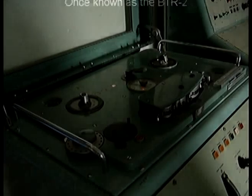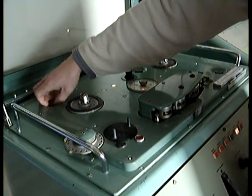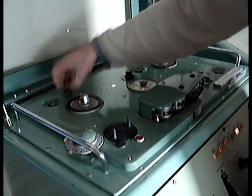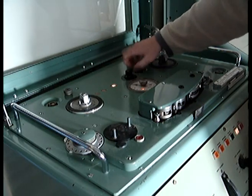The RD4 reel-to-reel tape recorder needs maintenance on a regular basis. The machine needs three oil wells to keep the oil flowing to the reel motors and the capstan motor. These are easily accessible at the top of the tape recorder.